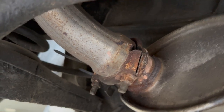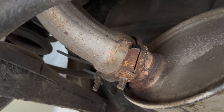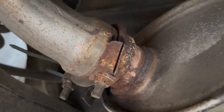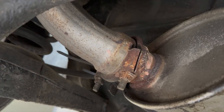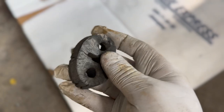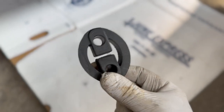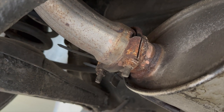If we look further down the pipe, we can see that the movement has caused the rear pipe to actually come loose from the rear silencer join. The U-clamp there is not actually gripping, so I need to put in some exhaust paste in the join and tighten those bolts. You can see how bad this rubber mount has got — it's lost all its integrity — so we will replace it with this lovely new one.